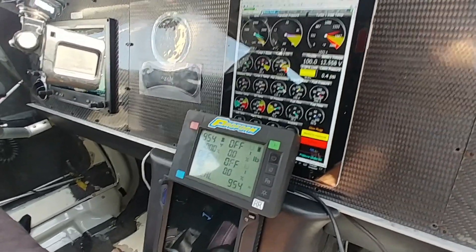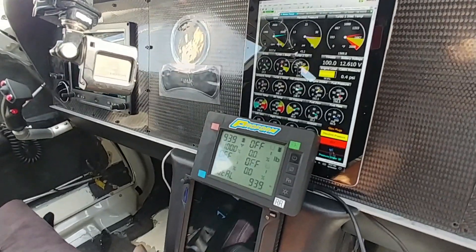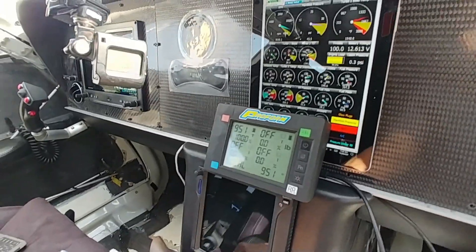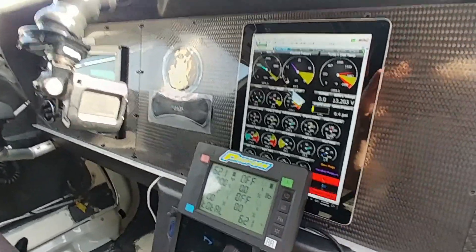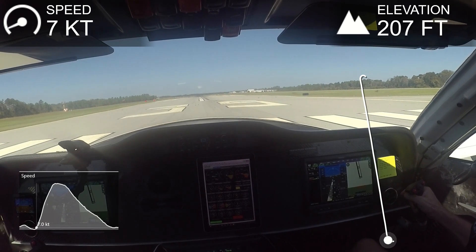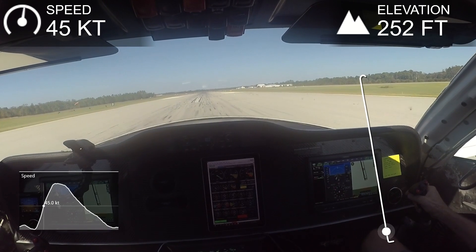The next thing I wanted to do was work on tuning — specifically, whether advancing the timing on the injection would help a little bit. It did make a difference. I've managed to get some more performance out of the engine, as you'll see coming up. As I'm tuning it I'm trying to keep the temperatures down, but adding a little more fuel and advancing the timing to compensate means temperatures end up slightly higher, so I still need to look at this some more. This is a runway 35 run the other day with those tuning improvements, and there was a fairly decent crosswind, so I had to keep some rudder in.